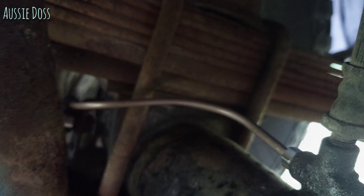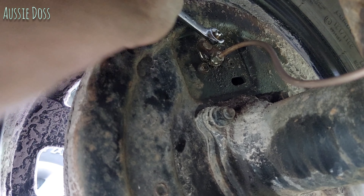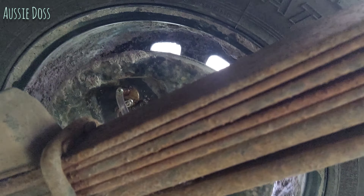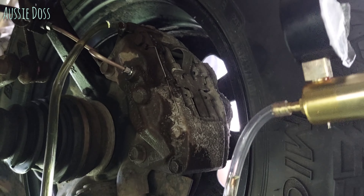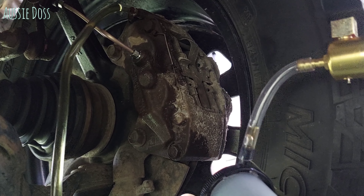But yeah, it's as simple as that. The only thing left to do will be to top the fluid up and bleed these brakes out, which is a lot easier with two people. We've got this tool but it's still a lot easier with two people to make sure your reservoir doesn't run dry. So the first thing you're going to need to do is crack off the bleeders — these ones have little plastic caps over them, look under them. This is the little tool we've got; essentially it's a tiny vacuum pump. You squeeze it together, it draws a vacuum and should suck any air bubbles out. You'll drop the vacuum and it'll pull some fluid through into the reservoir and hopefully pull the air. There it is working — you can see the air getting sucked out, and that means your brakes should be working after that. Just tighten up the fittings before you disconnect it.